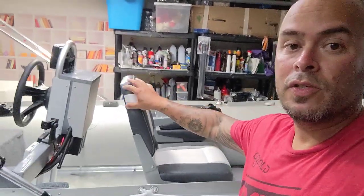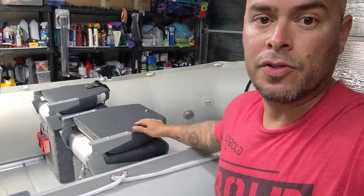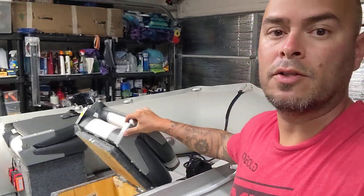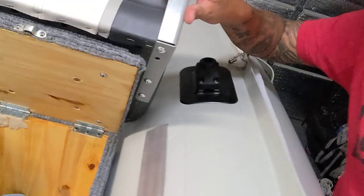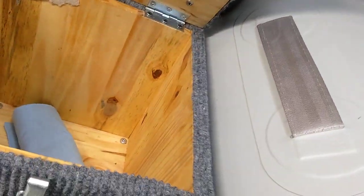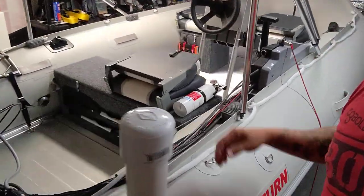First of all, as you can see, I have seats on here that I bought from Academy — these are just basic fishing boat seats. They're bolted onto custom boxes that I made, which all hold storage. In the middle on the bottom I have eight millimeter screws that go down into holes I drilled into the aluminum floor. I used eight millimeter weld nuts on the bottom side, and the screw goes in and stops flush at the floor — doesn't go past it. Same effect for the rear seat as well.